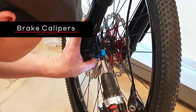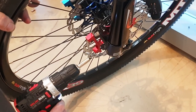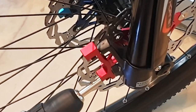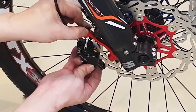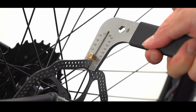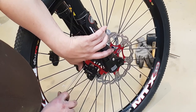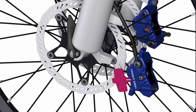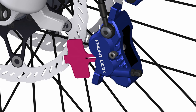Now let's begin the brake caliper installation guide. DNM forks typically use a 160 mm rotor by default. Although it's a bit challenging, we will use a 203 mm rotor. Since the 203 mm rotor is larger, it needs to be slightly bent for alignment. The dual disc brake calipers need to be installed and aligned one at a time. Therefore, until one side brake caliper is aligned, insert a bleeding block or brake pad block.